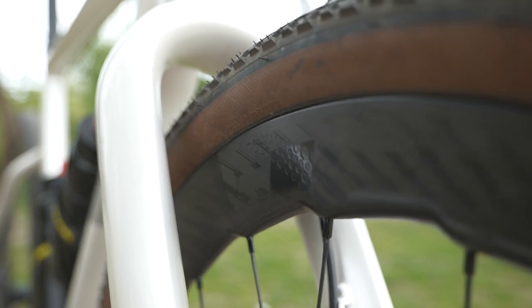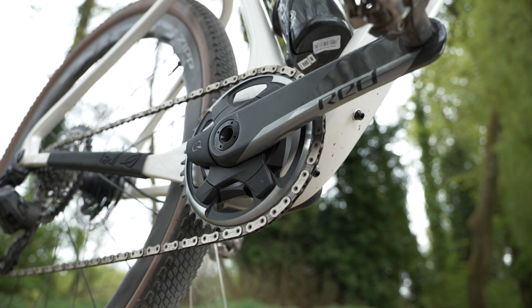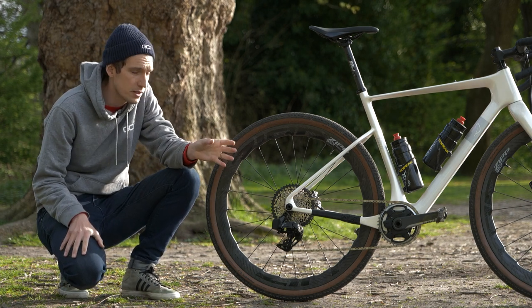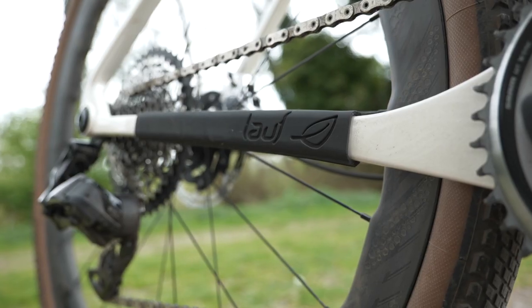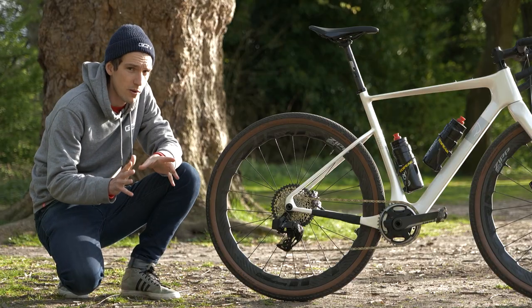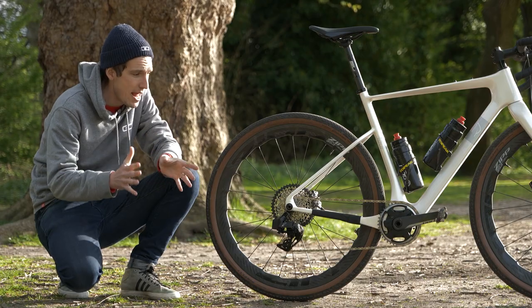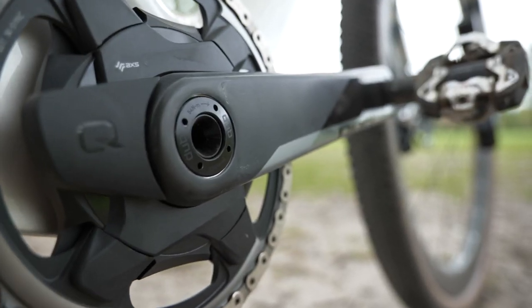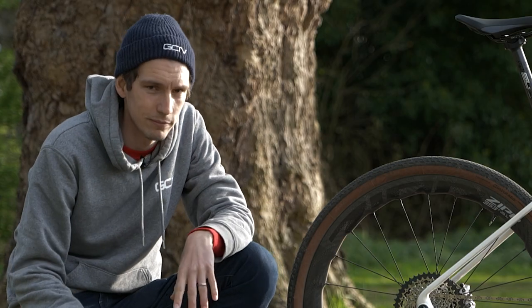To get that tire clearance, they've done some really cool stuff. Unusually for a gravel bike, this doesn't have dropped chainstays — where it comes out the back of the bottom bracket and then goes down — nor does it have elevated chainstays. They felt that both solutions presented too many compromises. Instead, to get that tire clearance, they've made the drive-side chainstay really narrow and out of solid carbon fiber, which is cool. You get that tire clearance, and it's also mega robust — so if you ever suffer from chain suck, six millimeters of solid carbon fiber isn't going anywhere. There's also a slightly different bottom bracket than you'd normally see: whereas a normal gravel bike uses a 68-millimeter shell, here you've got a 73-mil shell, which is what you'd normally find on a mountain bike, but you're using SRAM road/gravel cranks that give you a Q-factor more familiar to gravel and road riders. And yes, it is a threaded bottom bracket — of course it is, Lauf are Icelandic.